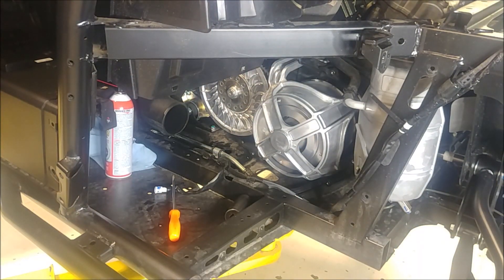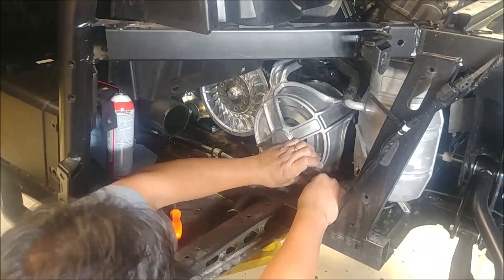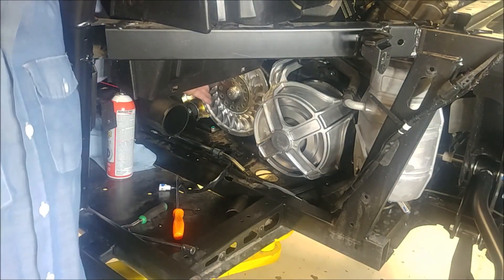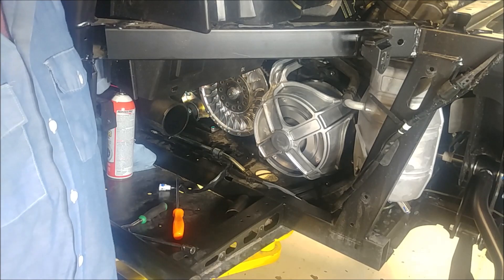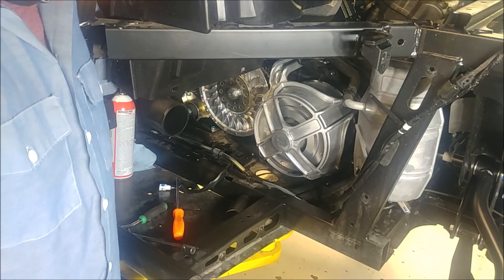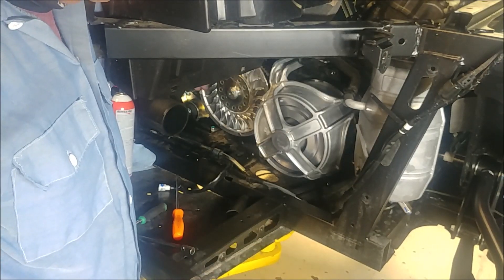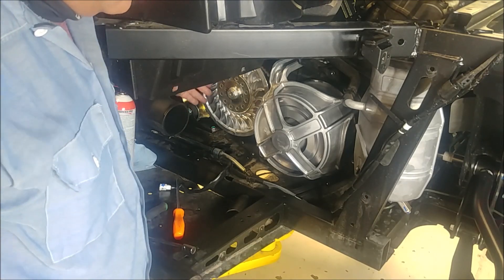Install your bolts. Last and final step after you install the bearing support cage: turn the sheave — this should not bind up at all. It should be nice and smooth. If there's any major resistance or binding, double check that your primary nut wasn't incorrectly installed. Make sure your bearing support cage wasn't installed cockeyed or skewed. This turns nice and smooth — I'm good with it.